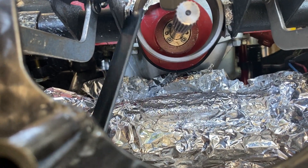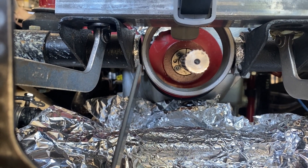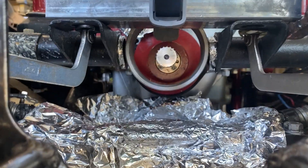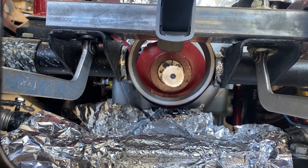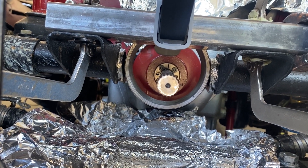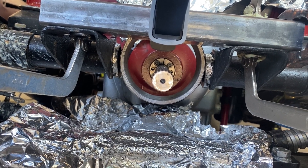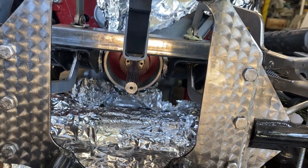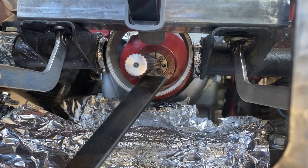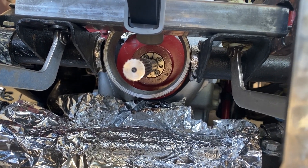Right there and right there are the ends of the original chassis tube. We've put in this new piece here, and we discovered the engine is actually sitting low on the stand. So we've measured this piece to be centered with the centerline of the chassis tube rather than the engine, because at some point we'll have to prop this engine up a little bit. But at the moment we're not going to change anything because it lines up with these supercharger mounts. We've also measured the distance between here and here to make sure we have enough allowance for the universal joint that's going to go in there.